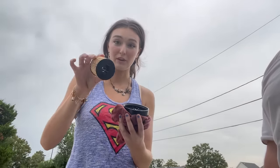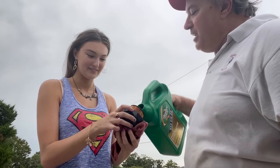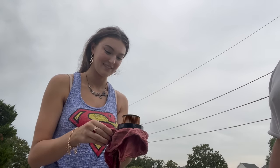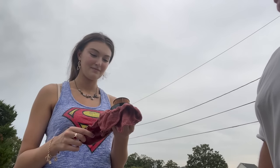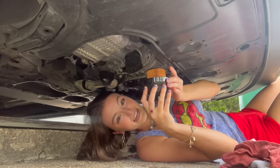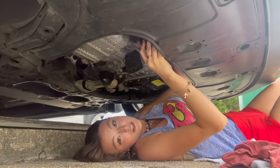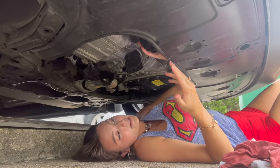She's so clean — I love it. Dad has a little trick: we're going to put the oil filter in, but first — what's the one thing you never do? You never put in a dry oil filter. Put it up on the inside and turn it to saturate the top until it goes — you've got to wait, it takes a little time. You've got to let it drink and saturate the whole side. When you're getting an oil change at a five-minute oil change place, the guy is not doing this — you're getting a dry filter. Now, install it nice and straight, start twisting until you can't really twist anymore, then tighten it fully. Your oil filter is changed and tightened with my hands, and now I'm going to use a tool.